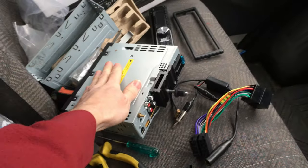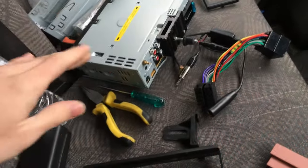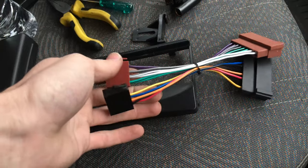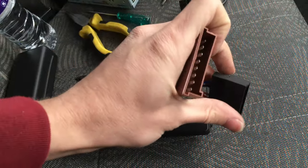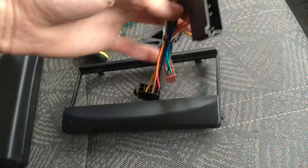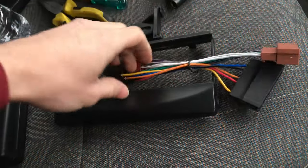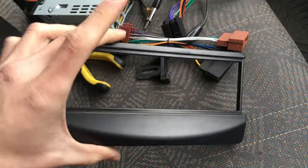What you're going to need is obviously a head unit of whatever variety. If you're not doing DAB digital radio, you won't need one of those. If you're putting in a standard head unit, you'll need the kit, which you can find on eBay, Amazon, or wherever. Basically you get two cables: this one is for the speakers, which changes the default Ford connector into the standard radio connector. This other one is for the power, converting the positive, the ignition switch positive, etc., into the standard connector.